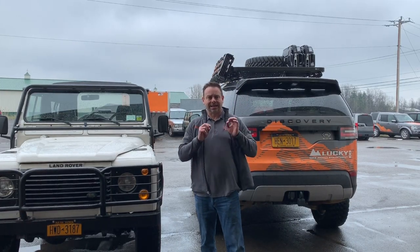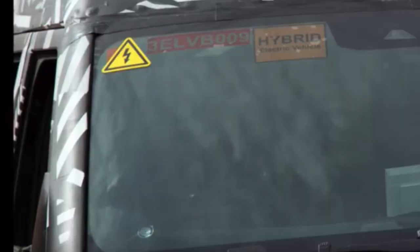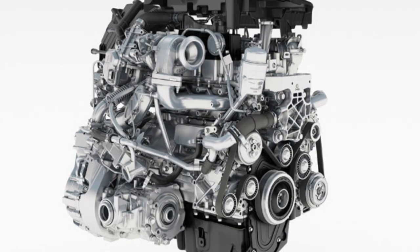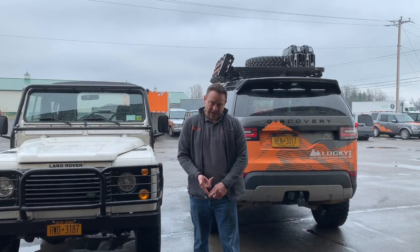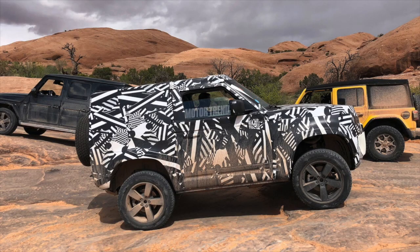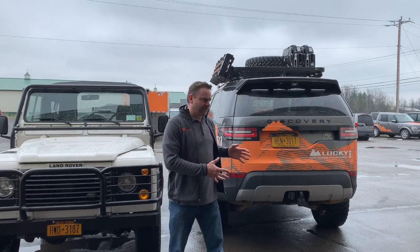Another feature about the motor is it is an MEV. A lot of people are all abuzz and angry — there were so many negative comments that it's an electric vehicle. We do not want our Defender to be an electric vehicle. It's an MEV: mild electric vehicle. It's going to be running a 48-volt system and it's going to have a generator-starter on it, so the generator can also help turn the motor over to give you that acceleration you need at low speeds. Don't be afraid of that — we could use any little bit of electricity to help in those low-end off-road situations.